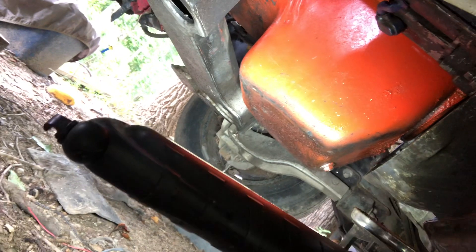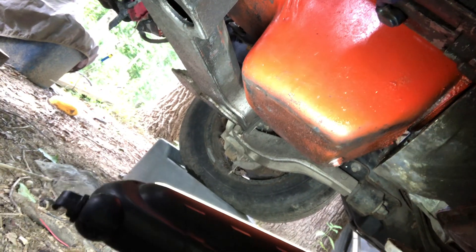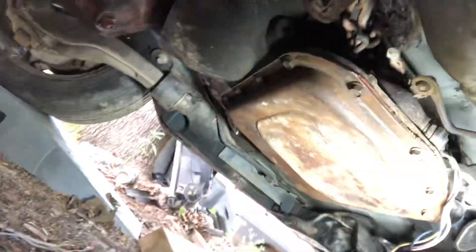There's my oil pan sitting away from the cross member — I could lower it down a little bit more but I don't want the oil pan sitting close to the transmission tunnel. It's all cleared good up there. Also, I'm pretty sure I can take the yoke off the Dodge driveshaft because the caps are the same size as the Crown Vic driveshaft, and I can interchange the yoke hopefully.